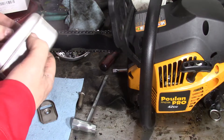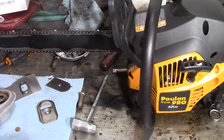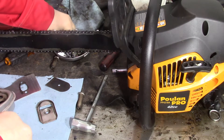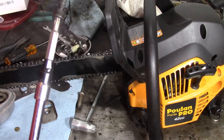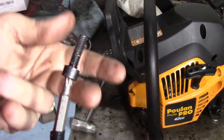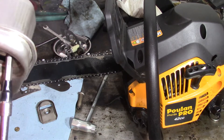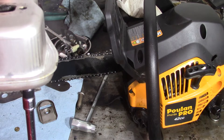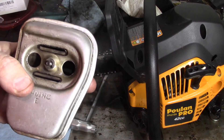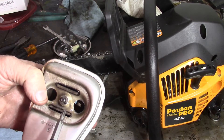It takes a star bit — mine's got an extension on it. The easiest way to do it is probably to get the screws started in the muffler first. If your bit is magnetic it makes it a lot easier. So you get your screw on there first, probably make it a lot easier getting it started. But that should help the flow since it's bypassing the baffle. If you want to get real extreme and you have a Dremel, you could still open this up a little bit more — mine is cooked so I'm out of luck on that. I'm going to try this route and we'll see.